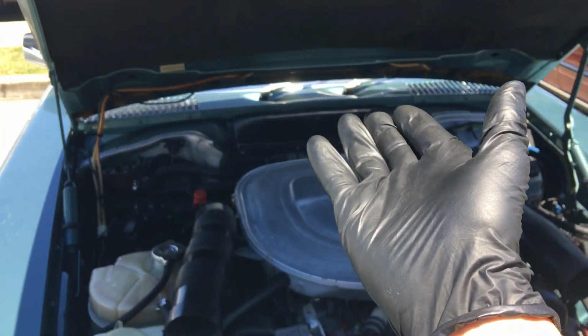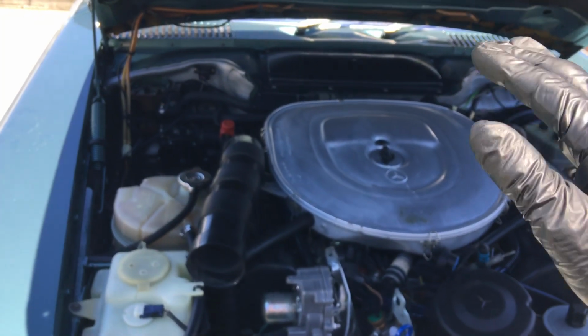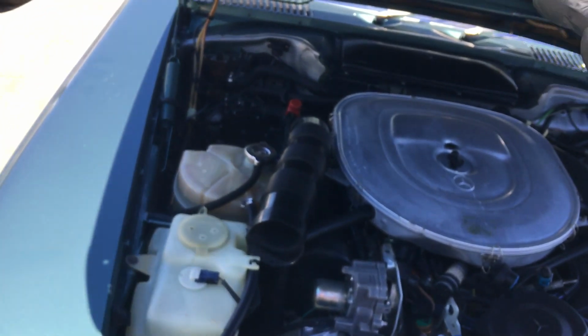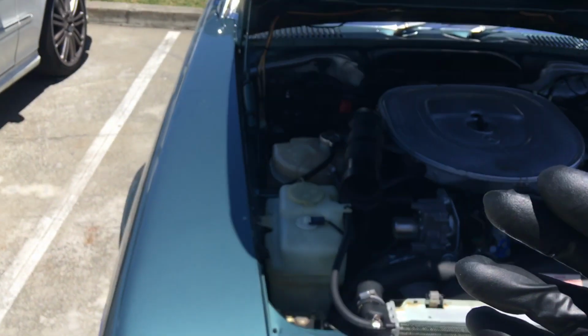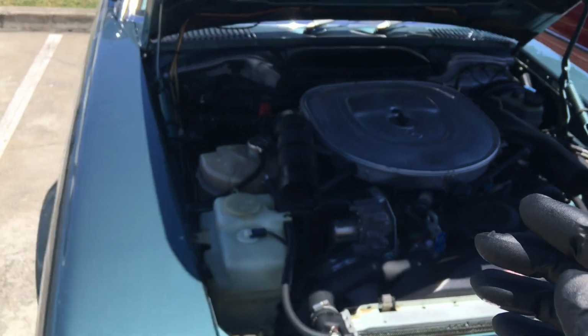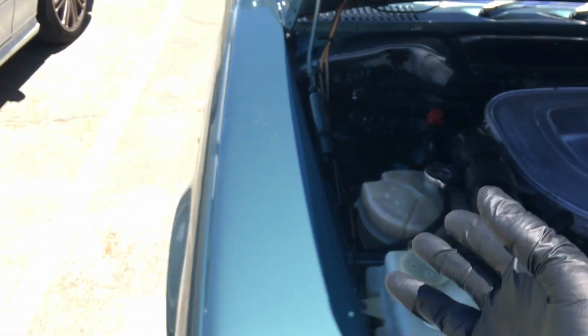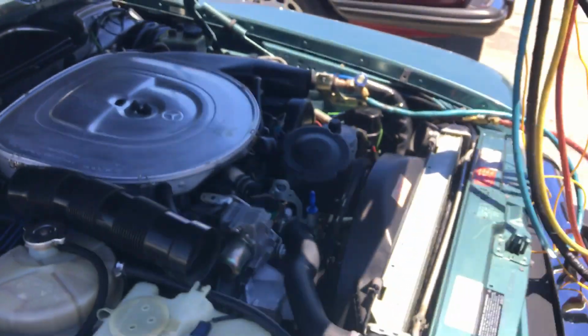And what is the result? Even though I'm getting 47 degrees out of the dash, and when I rev up the engine RPMs and let it cruise for a little while, it'll fall down to 45, 43, but it's only 66 degrees outside, and it's not a strong sun load, and we have a cool breeze. So the vehicle doesn't have a high load, even when I open up the windows, the doors, put it on fresh air.